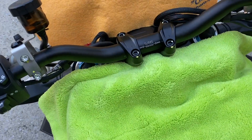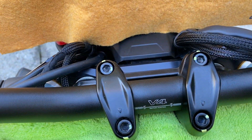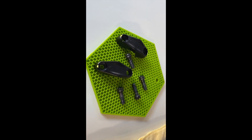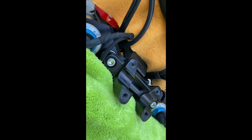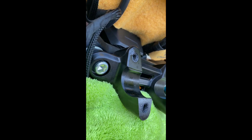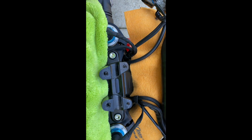The 6mm deals with these nuts on top — the same size as the standard clamp nuts on the Ducati. The Street Fighter is all nicely protected with the thick towel and chamois over the TFT. We're just going to unscrew these bolts with the 6mm and whip them off. The standard bolts and top clamp came off with minimal effort. You can see the bottom of the clamps with the tops off — they're actually angled, which is the problem with regular bar-back or lift risers.